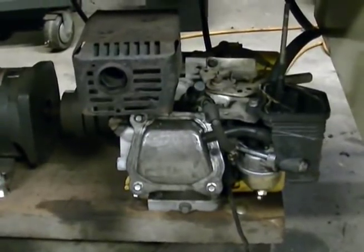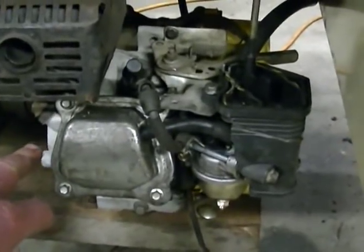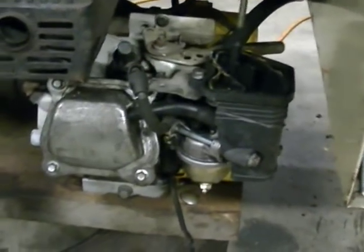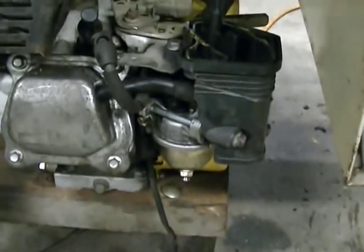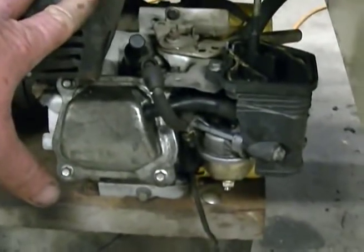So there's our new motor. So far, what I've done to this since the last run in the video: I've shaved 2mm off the head to lift the compression right up — we're probably close to 13 to 1 now by measurement. I've also added our variable mainjet, and we've almost doubled the efficiency of this motor straight up.